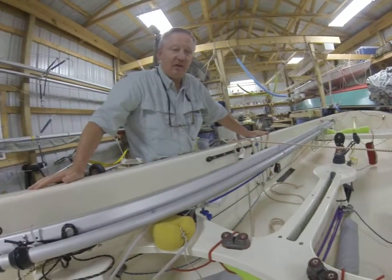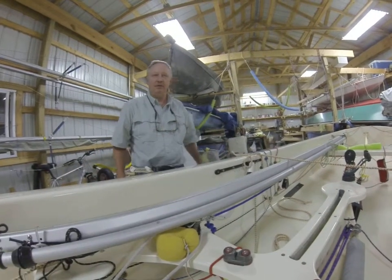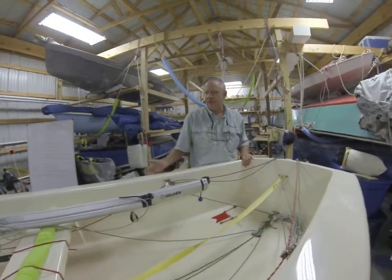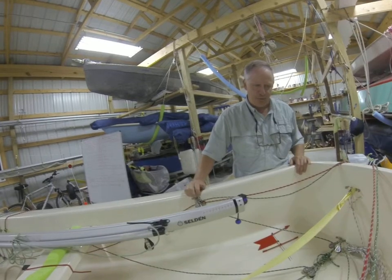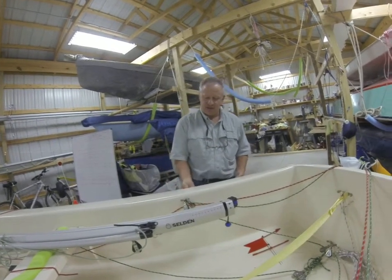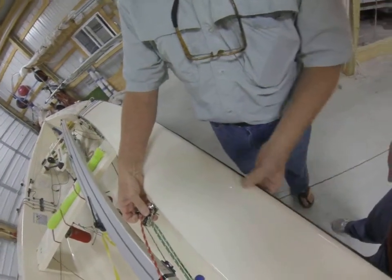Anyway, I think that about covers the inside setup of the Johansson windmill with the dual control system. I can talk about the arm length. I also want to talk about Ethan Bixby has a lesser control boat. He has single controls, and because I had them bolt these things in when I had the boat built, your option would be either to drill and put resin in and re-drill afterwards to put in with screws, or as he did, he actually drills through the outer thwart and connects his traveler arrangement and his other blocks out here.